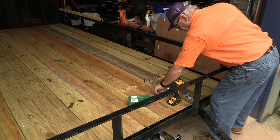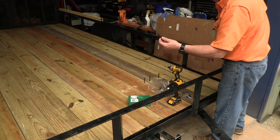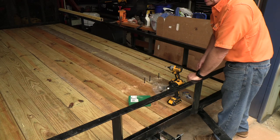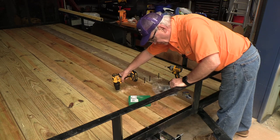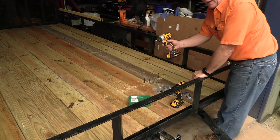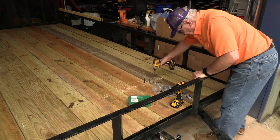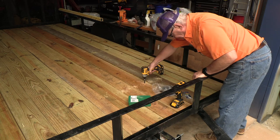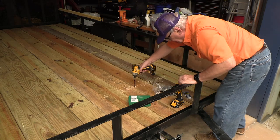To attach the deck I'm using three-inch T30 quarter-inch diameter trailer deck bolts. They go through the wood and cut threads into the metal, but because we bumped up to a quarter inch we need to use a 7/32-inch drill bit to enlarge the hole in the metal frame just a little bit. I'm using an impact driver to drive these — you can hear it when it catches the metal, it makes the threads and then just goes. We have 66 of these screws to put in.